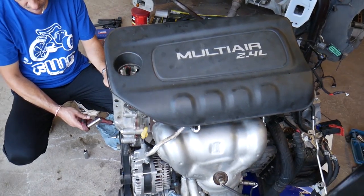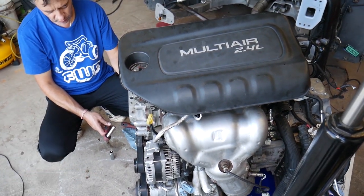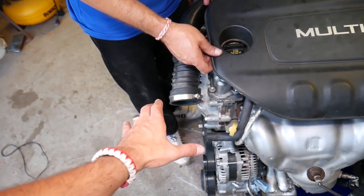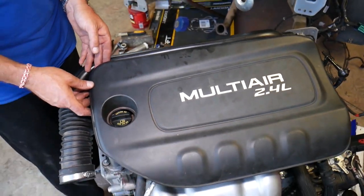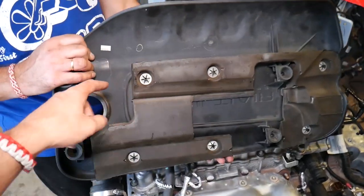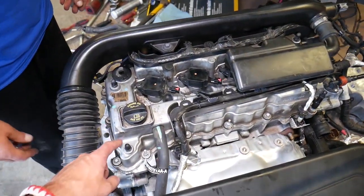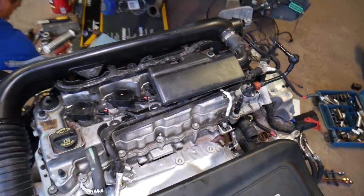If the engine is in the vehicle, when you open the hood you're going to face it that way - so everything we'll be doing is on the left side. First you need to remove your engine cover - just pull it straight up. It has four rubber bushings that it attaches to, one, two, three, four, and those attach to the valve cover.